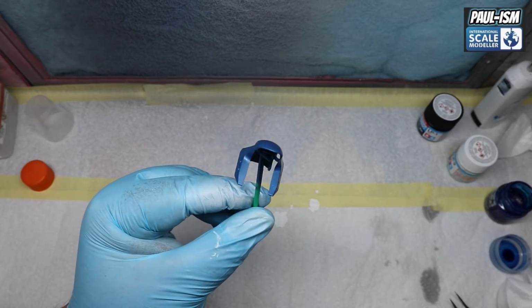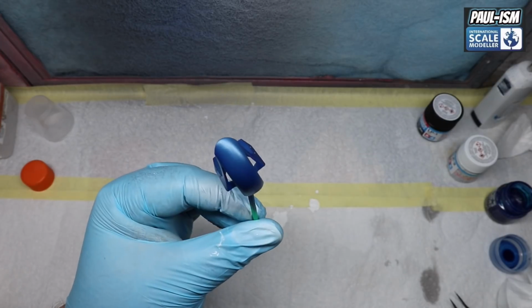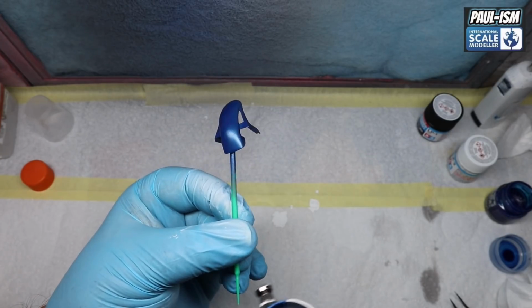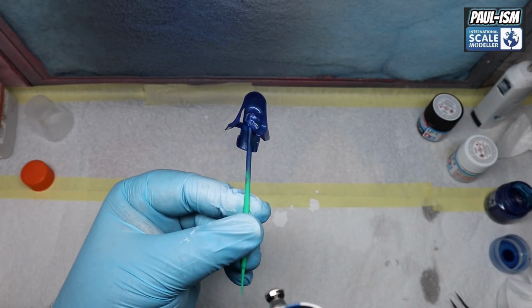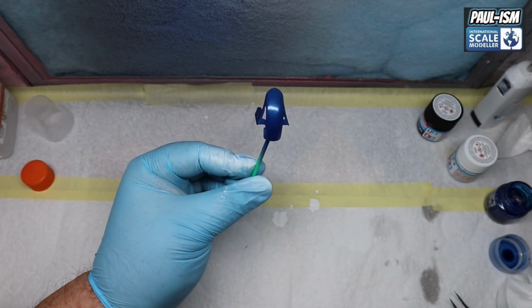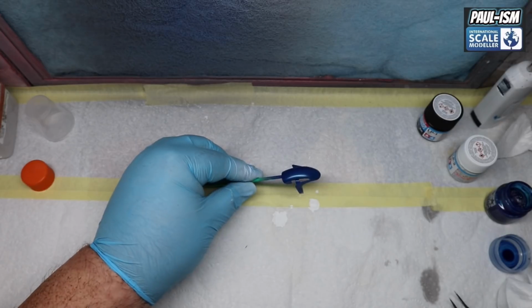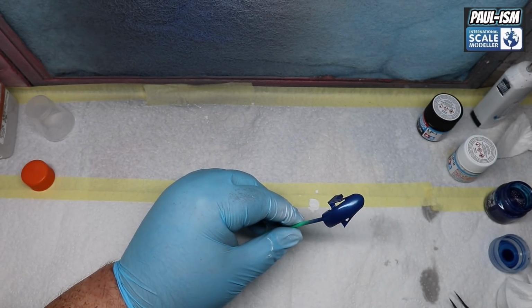So again, all different angles, because this component can be seen into at the front of the bike, make sure you get underneath, through the sides, everywhere. You don't necessarily have to do where the actual tire sits underneath, but certainly those side parts where they attach the forks, you need to ensure they're all fully sprayed. And again, nice even coat all around. Make sure we're happy with it. Have a good look. Use the light to your advantage. And if you are, we'll put it to one side.